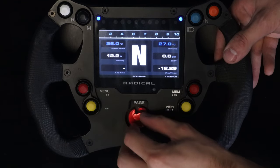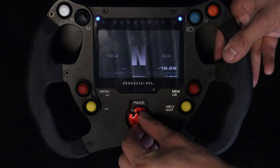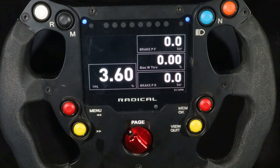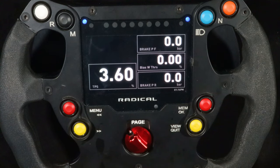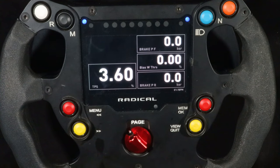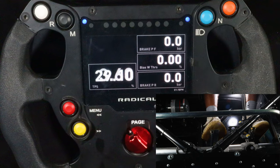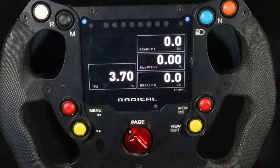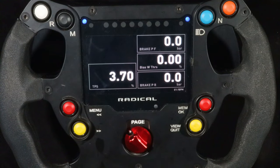Rotate the dial to ensure that it is secure and not loose, until you reach the throttle position and brake bias screen. You will now test the throttle position, max and min. The base number is 3.6, and this number should range around roughly 4%. Depress the gas pedal to its fullest — here we are seeing 103.10, which is in our sweet spot of roughly 103%. If this number is significantly more or less than 0.5%, it should be noted in your comments area.